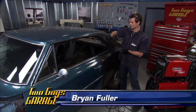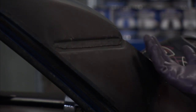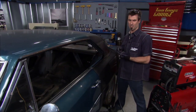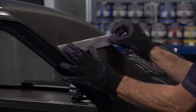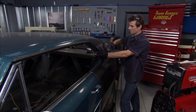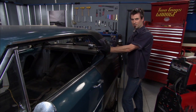Welcome back. Now we're going to work on this sail panel. Originally the way they put these two pieces together — your quarter panel and your roof piece — these were stamped as two halves. When they spot them together there's kind of a low area. A lot of guys would just go in with plastic filler, but the problem is you've got a chance for contamination or shrinkage. So what we'd like to do is take a new piece of 18 gauge metal, similar to what's original. We're going to put it in, scribe it, and TIG weld it back in for a nice clean smooth surface.